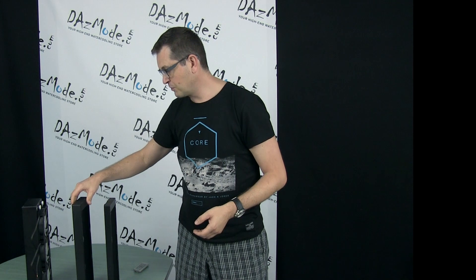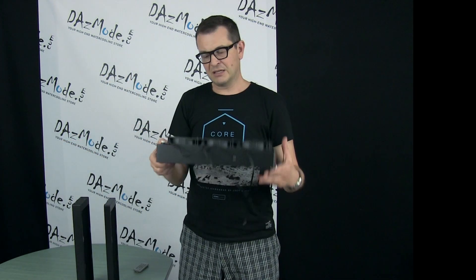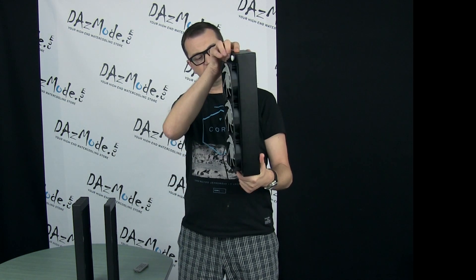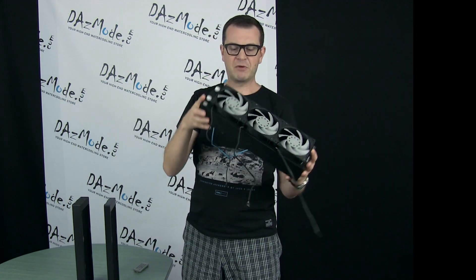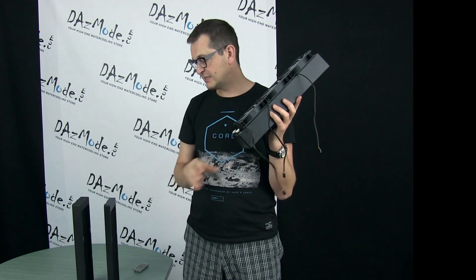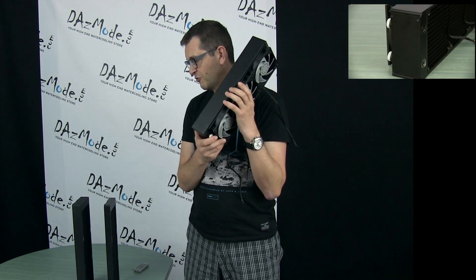The PE is not double but about 1.5 times bigger than the SE. The final and biggest radiator in the lineup is the XE — this one is about 65mm thick. It has the same medium FPI of 17 as the SE, and it also has a slight difference from the other models: it has two extra ports, so you can have ports from one side and the other.